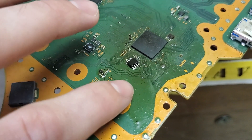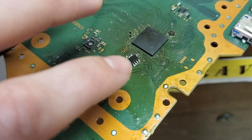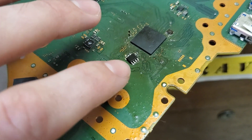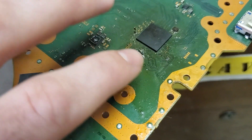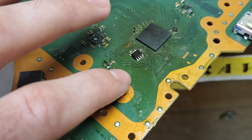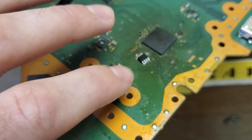You can take this BIOS chip and attach it to a smaller board in order to recode it on your computer. I'll show you what that little board looks like and hopefully link it for you. You'll have to desolder it from the board you're working on, attach it to that smaller board, plug it into your computer, clear the code, and then recode it so the console knows the correct configuration.